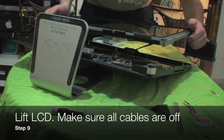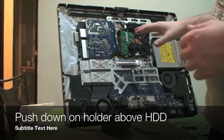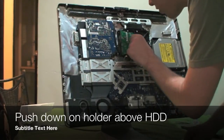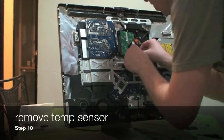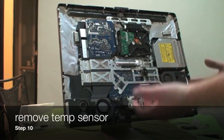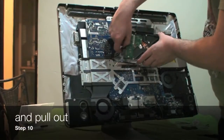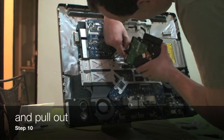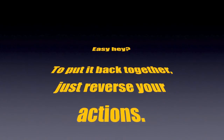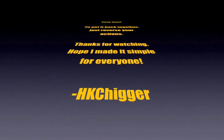Once you remove the LCD, you're going to have access to all of the innards of the computer. Just pull down on the little latch on top of the hard drive. Remove the temperature gauge on the hard drive, and make sure you pull down quite hard on the latch. And you're going to be able to just pull out the hard drive just like so. Remove the SATA cables — both power and data — and you're free to go. Of course, that's quite easy, and just do it in reverse in order to put the computer all back together. Thanks for watching. Have a great day.